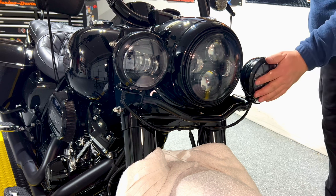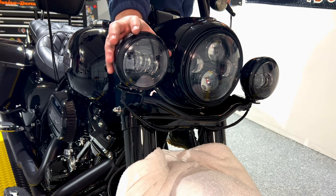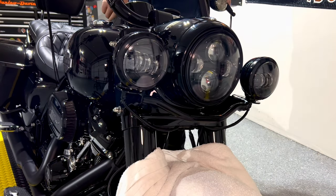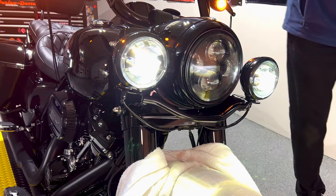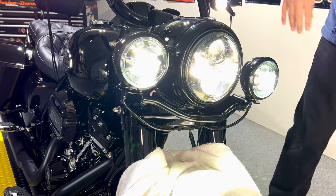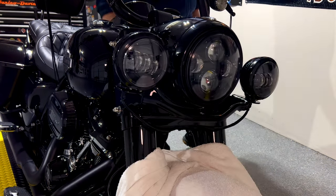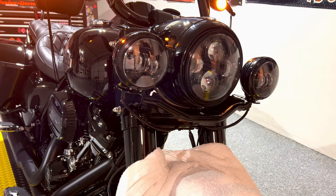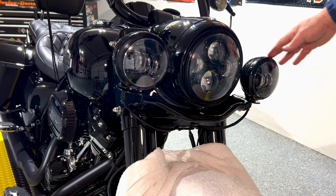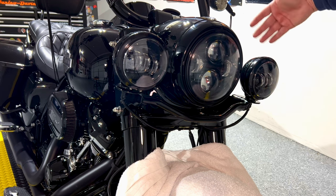I still have to adjust those lights, so I'm gonna do it during the riding season — I'll take the bike next to a wall, measure the distance, and align everything properly. You'll just have to unscrew this screw and you'll be able to move the lamp the way you want it. This is on, off, and accessory. I prefer if the lights were off during accessory mode, but as long as everything works properly I'm happy. I love the upgrade mainly for the look of the bike — I always liked this old-school look with the three lamps up front. I'll also have some additional light, which is great. This is an outstanding upgrade for somebody that has a Road King Special.